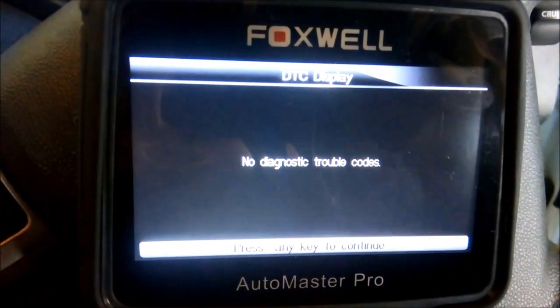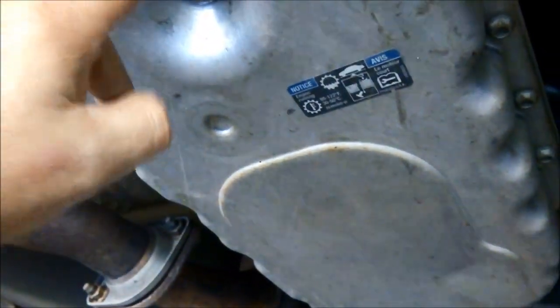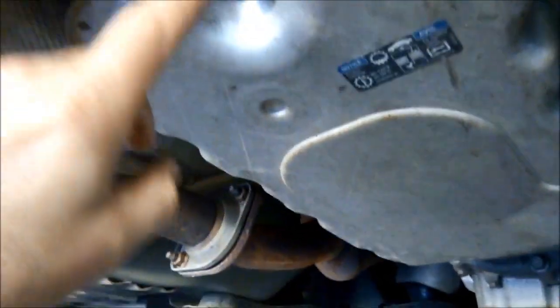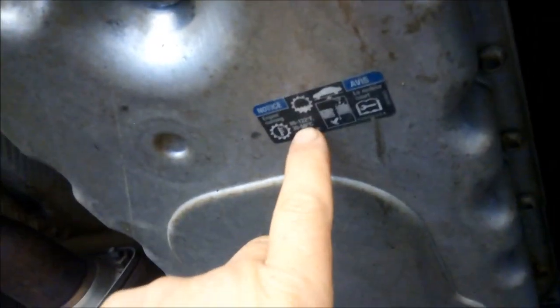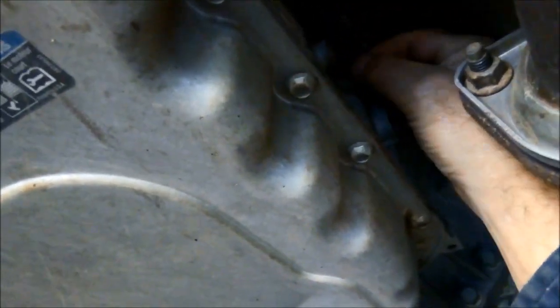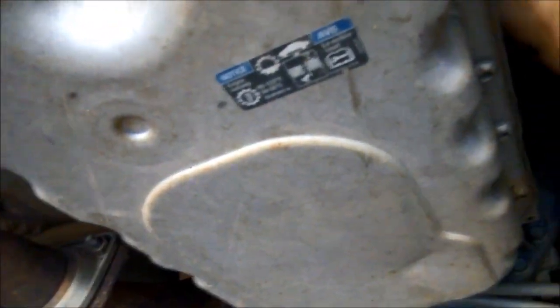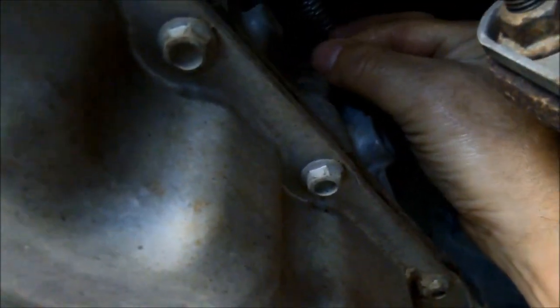Did the vehicle-specific code check and there are no trouble codes. Now to check the oil level — there's a little tube in here, about this long, and that's what the oil level should be at. You have to check it at 30 to 50 degrees; if it goes over 50 degrees you need to let it cool down. You check it with the motor running. Under the filler there's a little plug on the driver's side — the right-hand side of the vehicle — and that's where you can fill the fluid through. You can also overfill it through the tube and let it run out until it just starts trickling. You just pull that little clip up and you'd be able to pull the whole thing.